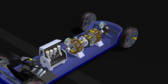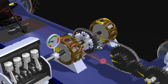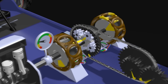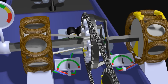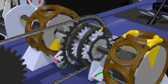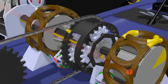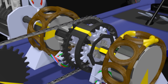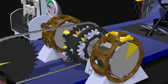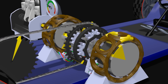In reality, Toyota rotated the driveline 90 degrees and replaced an axle with a chain between the ring gear and differential. Nothing really changes — the ring gear and MG2 are still directly connected to the wheels. This is how the hybrid drive is built into the first and second generation of the Prius: all engine parts in line, with the battery in the back of the car. In the third and fourth generation they added another planet gear set, called the speed reduction device, but what it actually does is speed up MG2, so that they can slow down all the machines together by changing the final gears. And Toyota is still fiddling with that. They have this drive now in the Prius, the Auris, the Yaris, and a four-wheel drive, all with different ratios for their planet gears and their final gears. Apparently it's not easy to get that right.